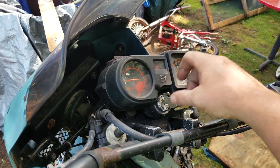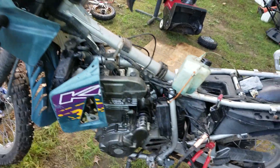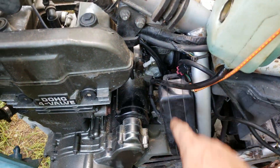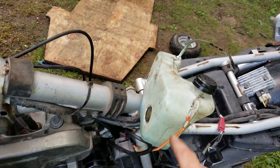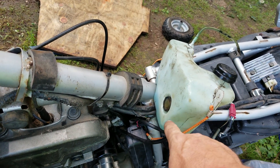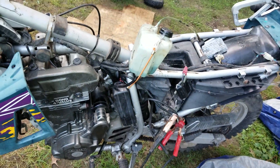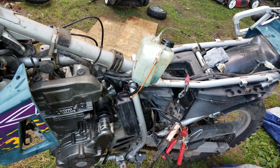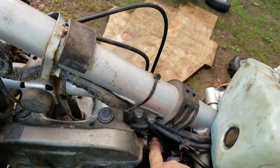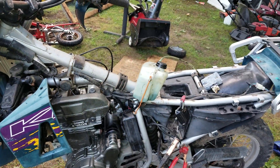If you shut this down — that's exciting. I fixed the cover here, the bracket, put that on there. I'm using a KE100 oil tank reservoir with two-stroke mix in it to run the engine — that's what I'm using for a fuel tank. And the pull choke right here that I put on there works great, so no problems with that either.